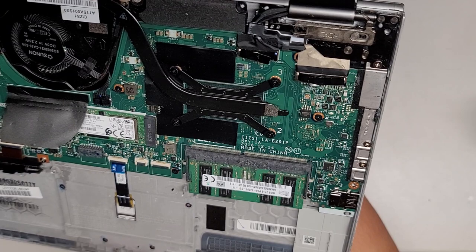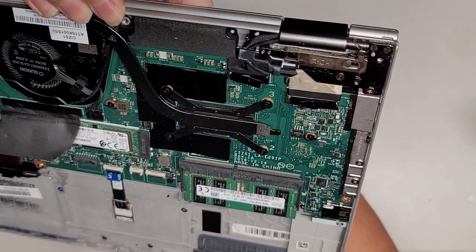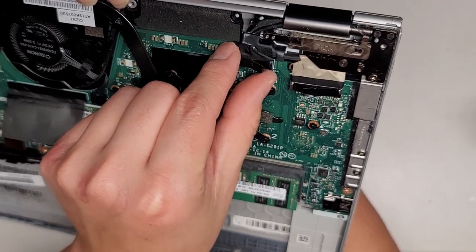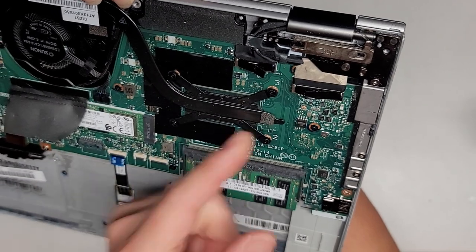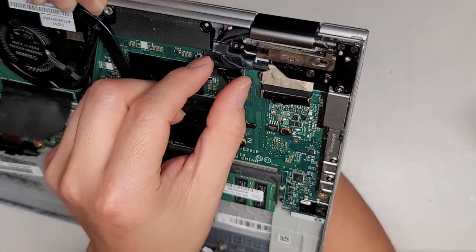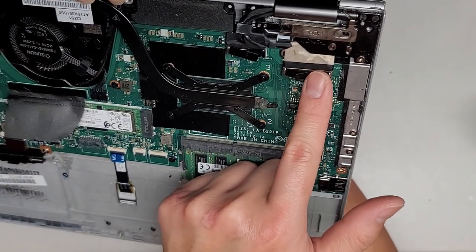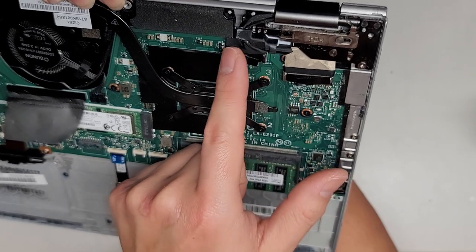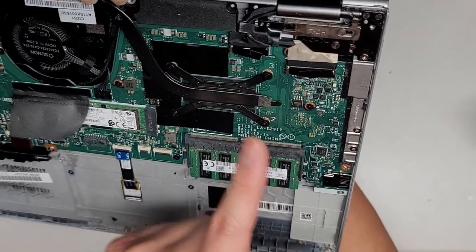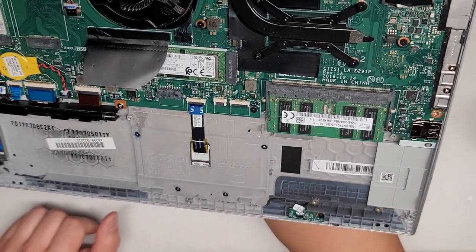Make sure you press and hold the power button for at least 15 seconds to make it a lot safer. If you didn't, I warned you. These cables you'll grab here and then pull them up — a lot of times they don't come out easily, so get underneath with your fingernail and pop it up while pulling with your other hand. This one is probably the LCD LVDS, and the other one is probably for the touch screen, camera, microphone, or stuff like that.